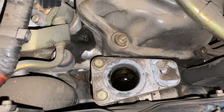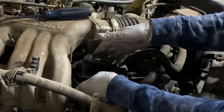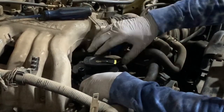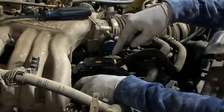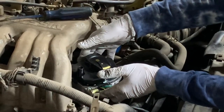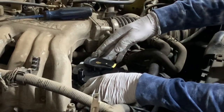Here is a good look at where the distributor sits in the valley of the engine — there is a gear driven off the camshaft that drives the distributor. Now I'm putting the new distributor in place. The rotor will rotate counterclockwise as you set it into place. If you end up being off, all you have to do is lift it up, move the rotor a little bit, and set it back down until you are exactly where the old one was. You can see as we put it in the rotor was spinning, so we were a tooth off. Make sure when putting the distributor in by hand that it goes fully down to the engine block — do not use the bolt to pull it into position. The rotor is going to move quite a bit if you are a tooth off, so you don't really have to worry about not being able to tell.